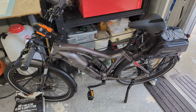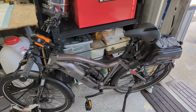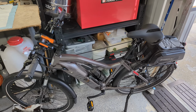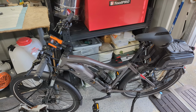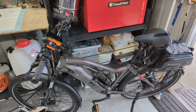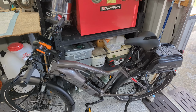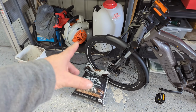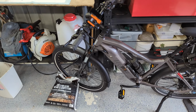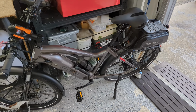Nothing else. I might just check the tires, because brand new tubes, they stretch, so I want to make sure they're still, I run 50 psi in them. It says max 65. I think that's a bit too hard for these type of tires, but I'll put 50-55 in and should be right. This has got Schrader valves like a car, and I think they're good for about 80 psi or something like that. When you start going higher, you need those Presta valves.